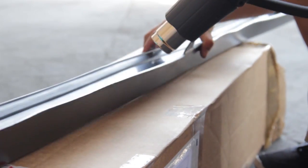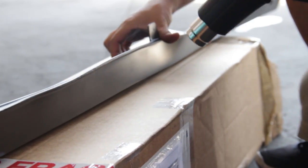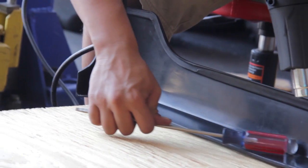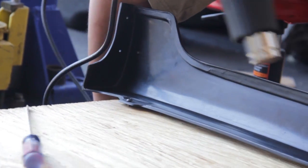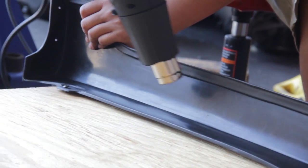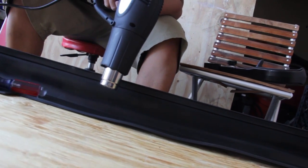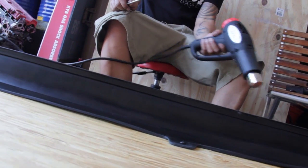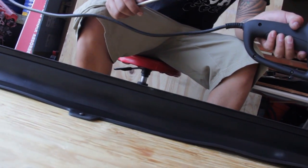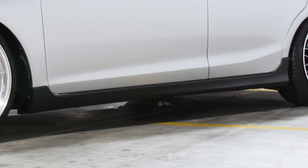It actually took me about two hours to get the kit back to shape. I'm taking the heat gun and slowly transferring heat along the sides of the kit. I pulled out a piece of wood to get a flat surface and get the kit smooth and even again. I used the screws that came with the kit and drilled it right onto the large piece of wood so it didn't move around, then used a long screwdriver or flat surface to flatten it back out. The biggest tip: take your time. Let your kit sit in the sun for a day or two; if it's not hot enough, that's when you pull out the heat gun to get it back to its natural form.